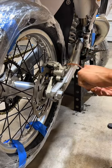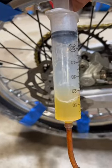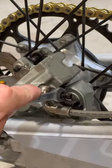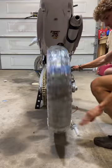Next, repeat the process of topping off your reservoir and sucking it through the syringe until it's all brand new fluid. Close your bleeder valve, top off your reservoir one more time, and then pump your brakes and hold them down again. Crack the bleeder loose and retighten it, then pump your brakes, and your brakes should be good.